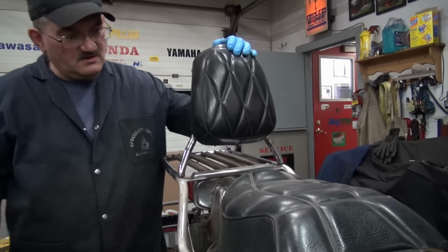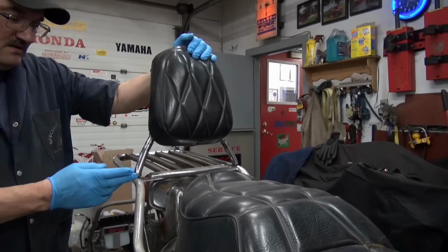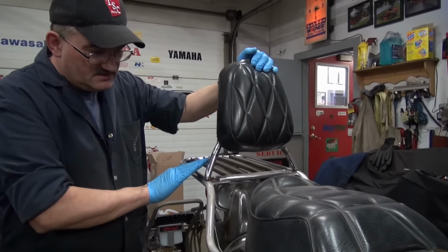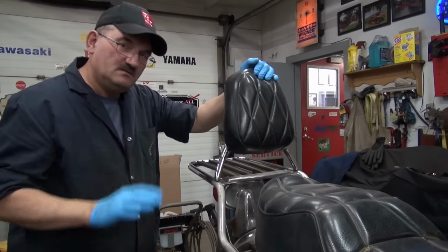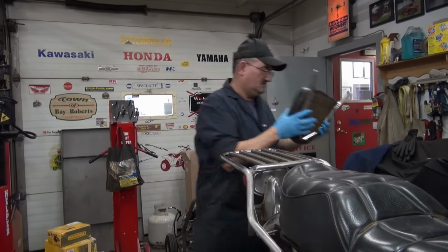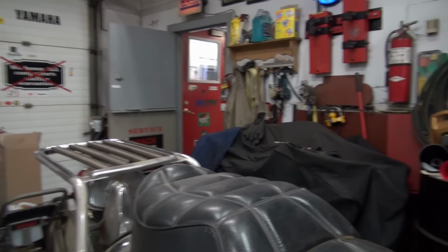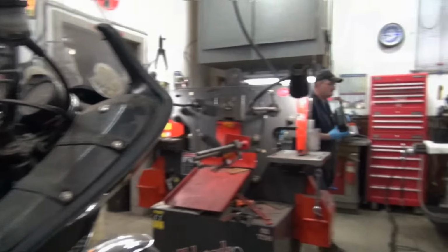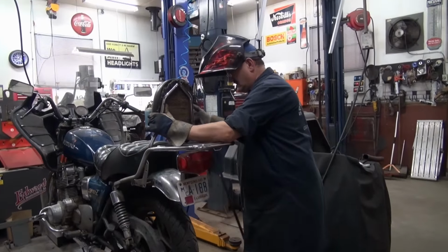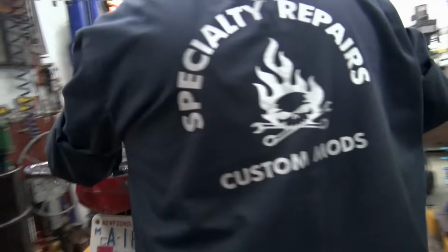So what I'll do is I'll take over the Miller welder and fill that in a little bit there, and a little there, and make up some gusset plates to go in here. It'll start to look like something very shortly. Tack that on the inside there now and get the angle right.